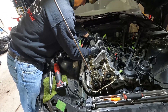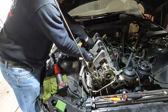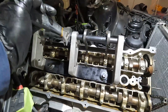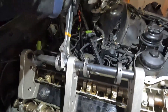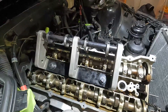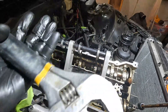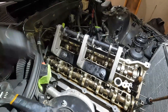I do have the special tool. It goes into the spark plug hole and bolts down to the spark plug threads. Using an adjustable wrench, I have that installed, and basically this is a cam that puts pressure evenly onto the camshaft. Now I can release all of my bolts at the same time and then release the camshaft smoothly in one motion, because it's all held down in multiple spots and there's no chance of breaking the camshaft.